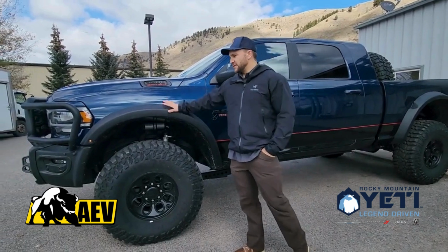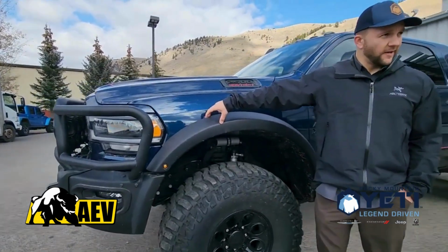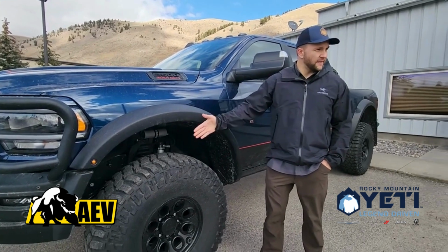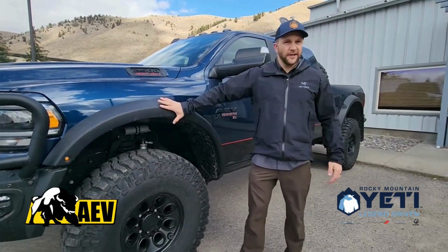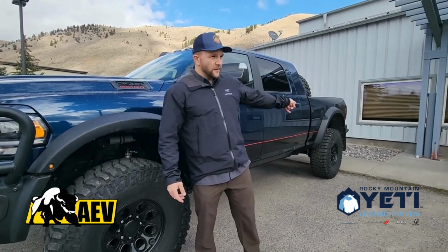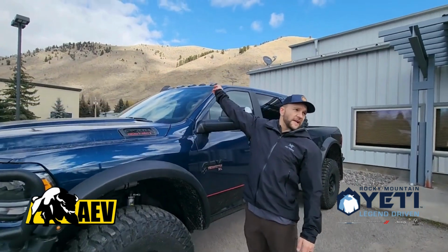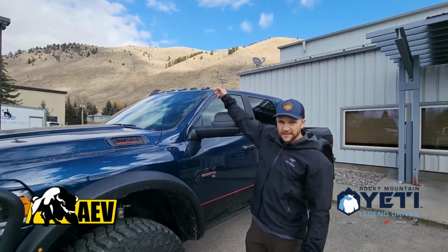I guess to talk about the fender flares. They're 7 inches wide. Okay, because the offset of the tire is so aggressive that we have to put a flare on the outside of it to keep it DOT compliant. But now the widest point of the vehicle is this flare. So to stay DOT compliant, we have to put marker lights on. So it's got marker lights in the front and in the rear. But now the truck is so dang big, you have to put cab clearance lights on it. Cab clearance lights are a DOT compliance thing for the height.